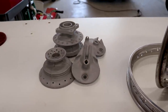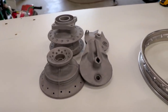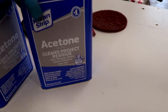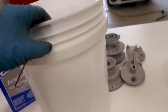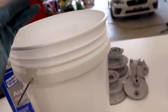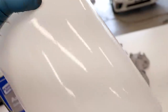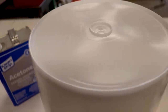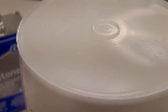Now we're ready to do some actual powder coating - probably the part of the video you guys all wanted to see anyways. So to prepare for powder coating, I'm going to blow all these parts off with the air compressor and then soak the hubs in acetone. Just got a plastic bucket here. You want to make sure, if you're using a plastic bucket, that it doesn't melt with acetone. There's certain plastics that can hold up to acetone. HDPE is a type of plastic that won't melt with acetone, and it's stamped right here on the bucket. So we're safe with this one.